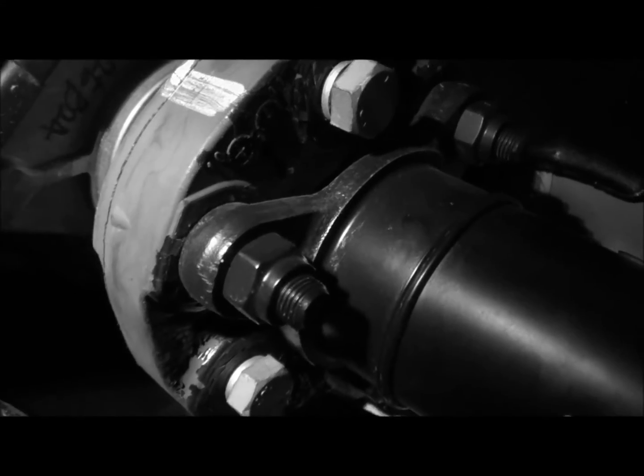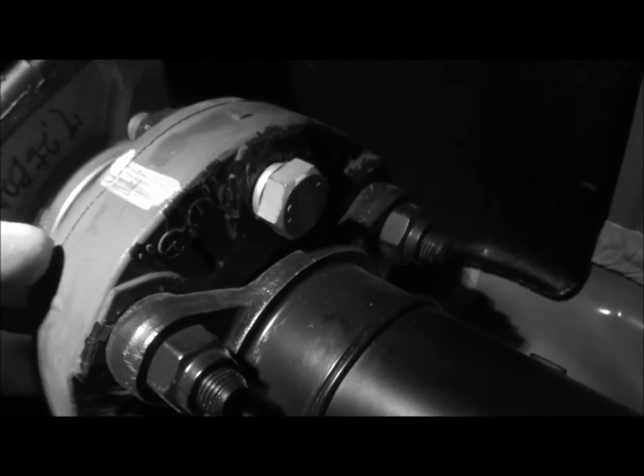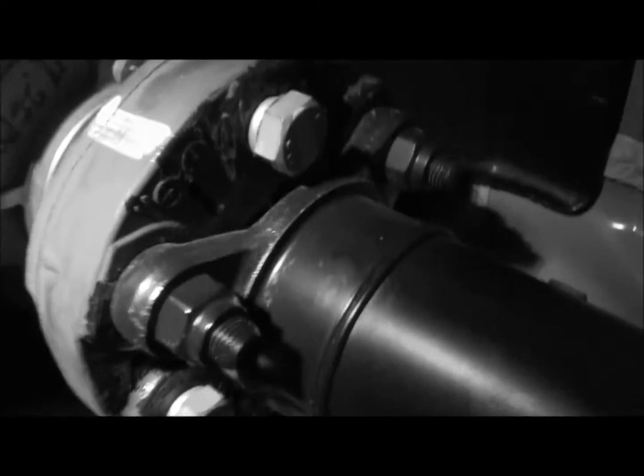They're just sitting there, so I'm going to keep my wrench on this side and get maybe a 1/2 or a 3/8 ratchet with a 3/4 socket, and it'll go a lot quicker. My ratcheting wrench wouldn't fit on either side due to clearance issues, but that's okay. If you can see here, we have yellow paint marked here and there, and that's going to be our positioning for when we put it back on, because for fitment and noise and all the clearances, it's always good to put stuff like this the exact same way it was, for the best fitment possible.